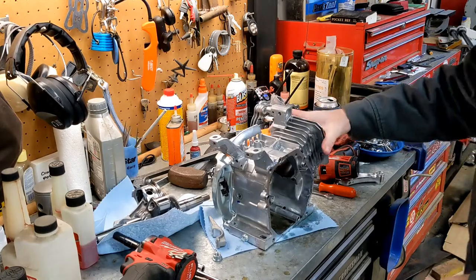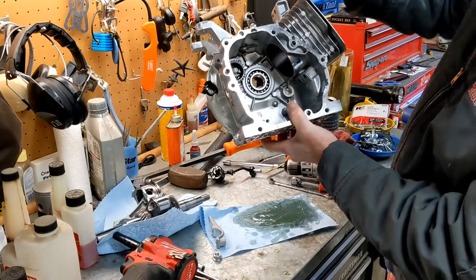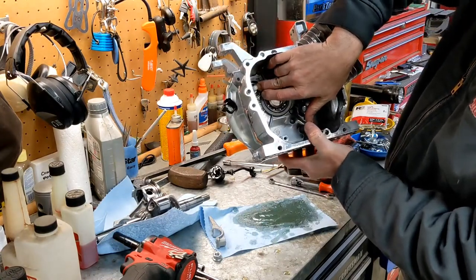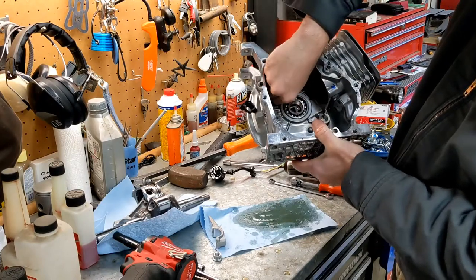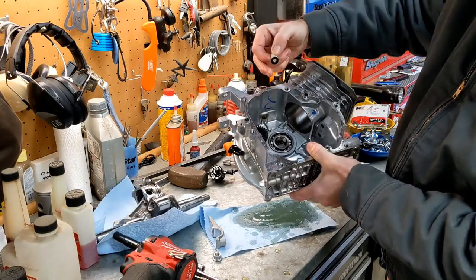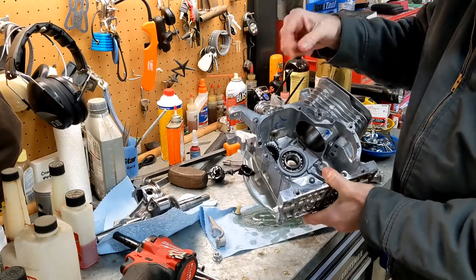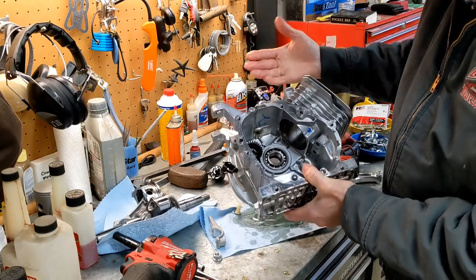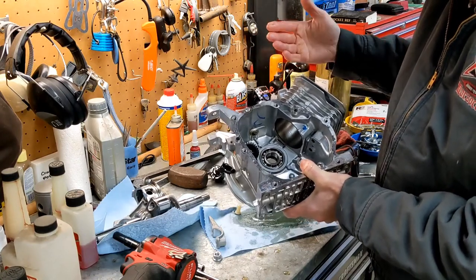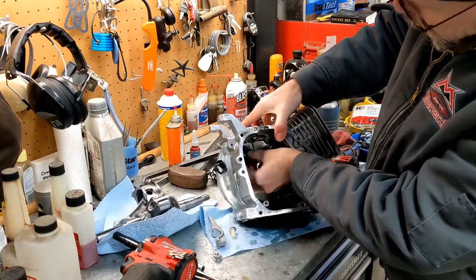Shocking. All right. And then the last piece in here, this is the actual governor. This is the thing that spins around, and you've got these two little metal ears right here, and this little plastic push pin, this piece right here, and those little metal ears push on this pin, and that in turn pushed on that little L rod that I just took out, and that would put pressure on the throttle against the spring tension, and that was what set the governing of your RPM. Now,